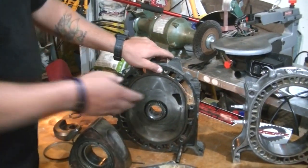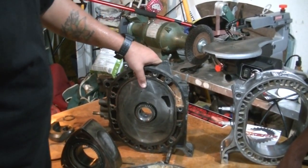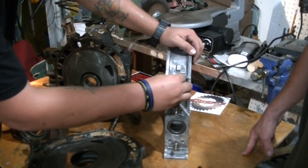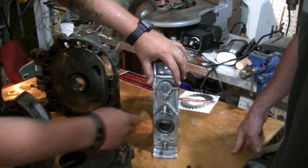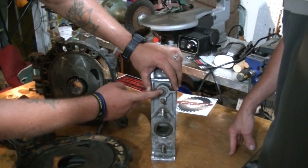Then from there, you can take these ports and completely seal them and go into something called a peripheral port. A peripheral port simply means that we take the housing, we punch out this little hole, and we put a plug in. Your intake simply sits here. These are now fuel inlets, and the peripheral port matches equally to exhaust and intake.